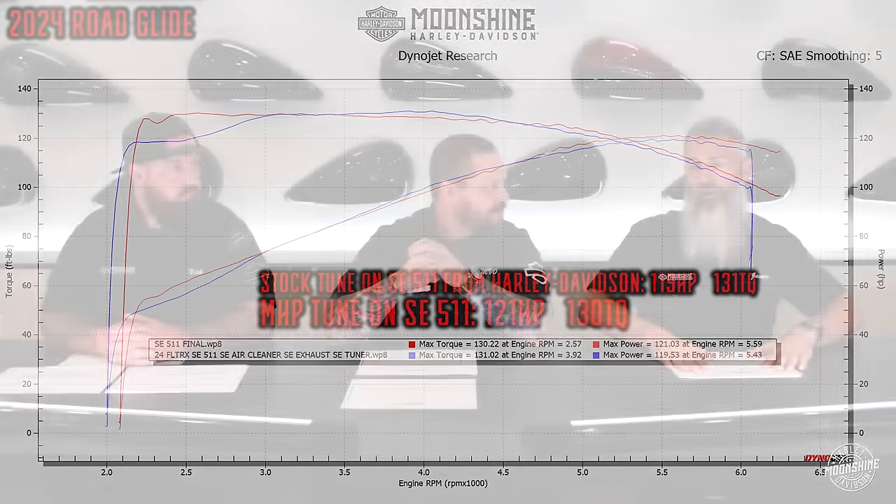What Harley's done to improve the whole flow of the induction system is they've gone from a 55mm throttle body to a larger 58mm throttle body, with a brand new intake manifold design. It's a shorter intake, putting the throttle body closer. They've taken the ports and made them wider, and really reduced the angle of the turns into the head. You can see it right here — this turn is a lot less severe than the older design. This new manifold out of the box is outflowing both the old stock and the 64mm Harley manifold, and it's feeding the inside valve of the head, which is leading to the results you're seeing on these dyno graphs.